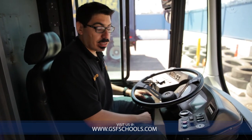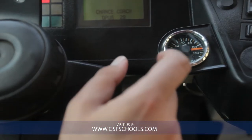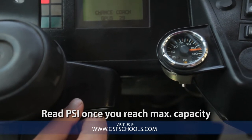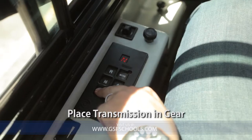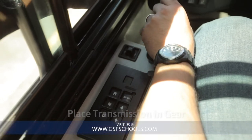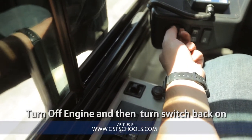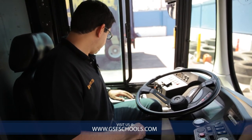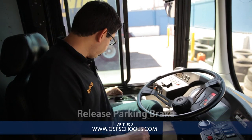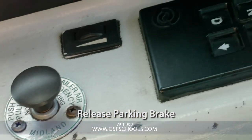If you get the pressure wrong, the examiner could fail you just based off of that. The needle has stopped moving — I've reached maximum capacity here at 121 psi. Now I must put the vehicle in low gear. As you can see, I'm now in low gear. I'll turn off the engine and flip the switch back on so I have the electrical system working. Now I will release my emergency brake by pushing it down, and I'll wait for the needle to stabilize.